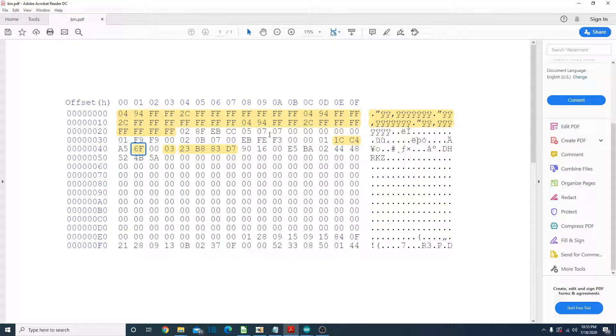There are other parts of this I haven't taken the time to figure out. Pretty much anything not highlighted, I either don't know what it does or haven't tried to figure it out. I do know there's going to be a section that controls the speedometer — the speedometer tables are definitely on here, and I'd assume the tach tables too, since diesels have a different tachometer. I believe all of this is on the EEPROM rather than the MCU, because the MCUs appear to be mask ROM — meaning the memory is made into the die and you can't reprogram it. I couldn't find any datasheets on this MCU, so I'm pretty sure it's a proprietary GM chip. Just because you can turn trans temp on and off doesn't mean it's easy to add trans temp — it's not like a 2005 cluster where you can just flip the bit and add the sensor.